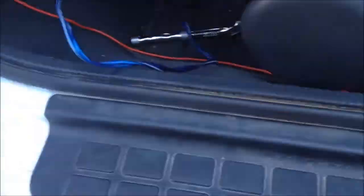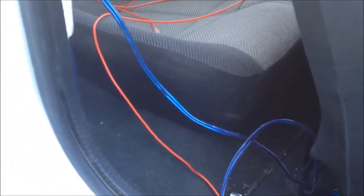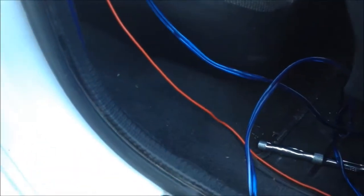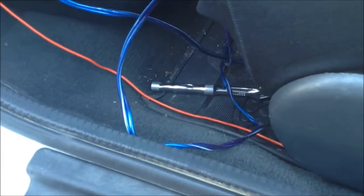I thought about repainting and respraying the door hinges black, but I'm not going to do that because it'll screw my door alignment up and they shut great as-is. I'm going to run all my RCAs through the center and my door speaker wires down the center so they're away from the power wire. I'm going to run my one remote wire back to a relay — the NVX major relay — which has built-in timing and all that. I might just use a regular 30-amp relay.